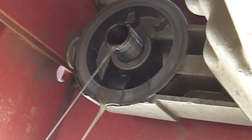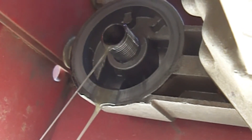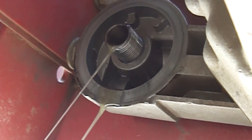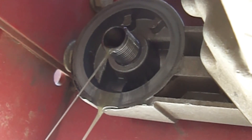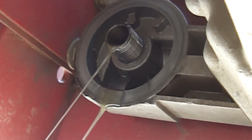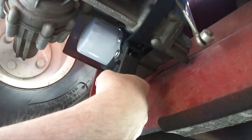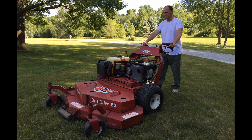I repeated this procedure until the drained oil returned to the same color as the new added oil, which in my case took six separate drains totaling six quarts of new oil. Also remember when you perform this procedure, you'll see thousands of tiny air bubbles in the drained oil, which is completely normal. And last, I tighten the oil filter. Now everything's back to running at optimum performance.